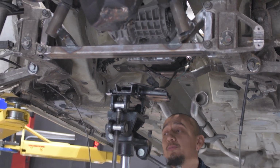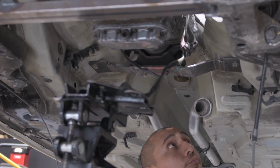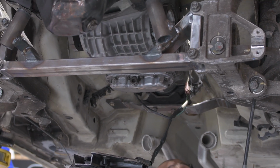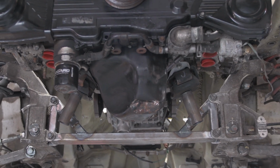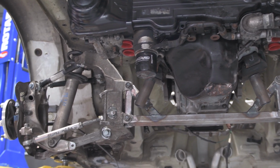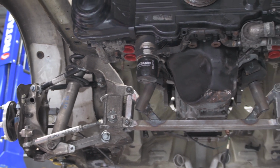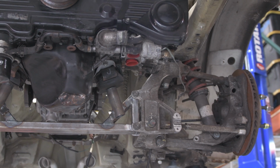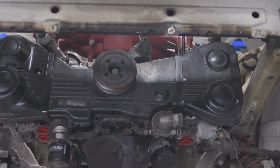Because honestly, fitting an engine into a rear engine center transmission car is really difficult because there's no hoist or anything to mock everything up with. So what we did was we utilized this transmission crossmember, we mounted the engine in there, and then we have an aftermarket pan and everything going in just to make sure that we got all our clearance right. And then from there, what we'll do is we'll create a rear cradle that links into the OEM GT3 motor mounts. And then that way the transmission and engine are mounted as they would be in a factory Porsche.